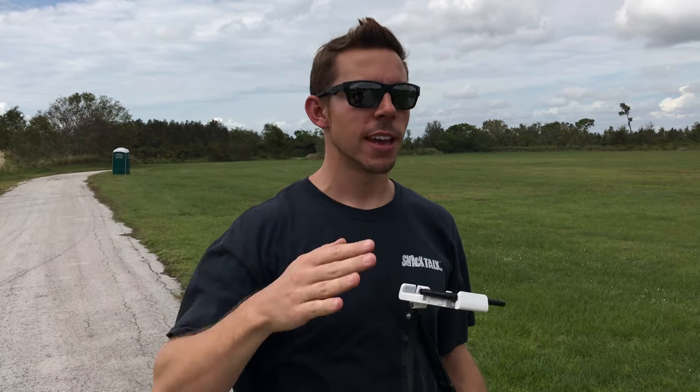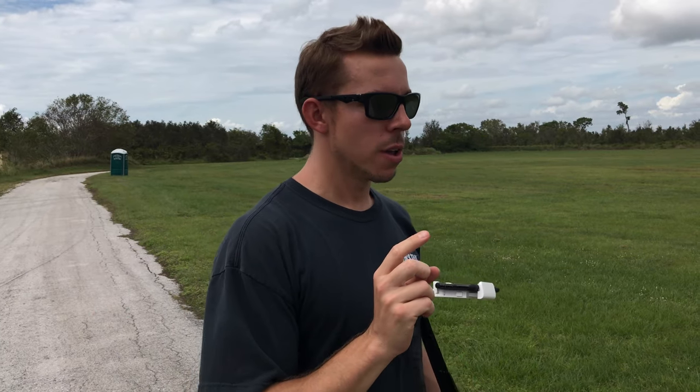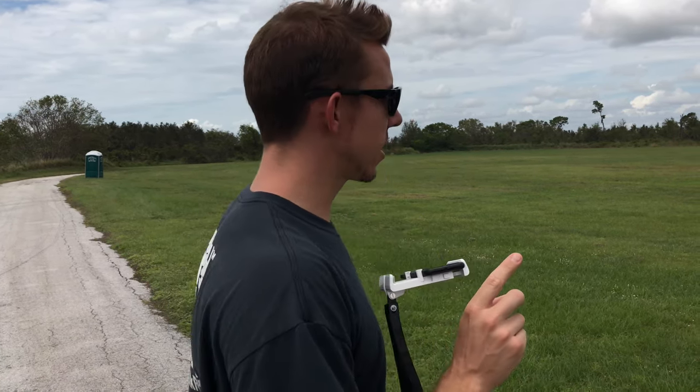So, have you ever set up a new V-Bar? You've done your swash plate leveling, you've put the swash leveling tool on it, and everything's perfect, you've set your pitch, everything's wonderful. Go outside, you fly, you pirouette it, and it's like this the whole time. The disc wobbles, and you're like, what the heck? So this is gonna fix that. So what we're gonna do is we're gonna use the trim menu in order to achieve a perfectly level swash plate. So let's give it a shot.